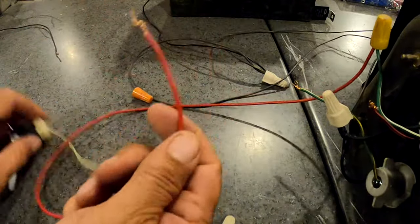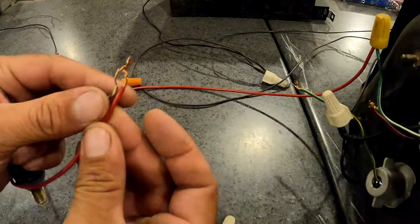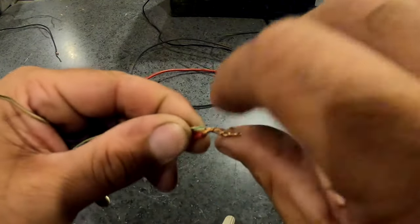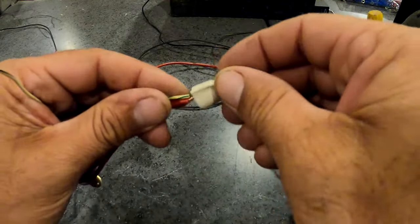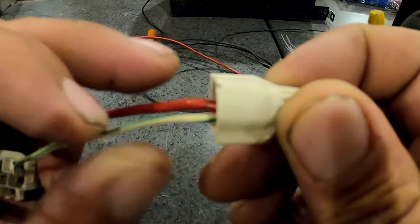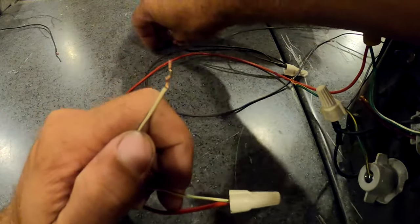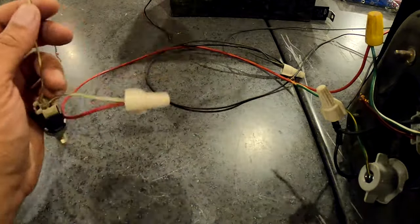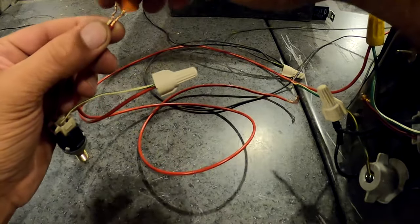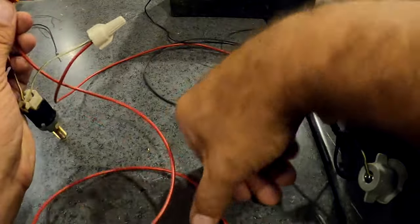You'll take your switch — this is a two-wire switch from a 97 Civic. Some have four wires, but essentially we'll put the white with green wire to the brake lights, and we'll wire-nut the other one to the wire going to the battery. So that's connected now.